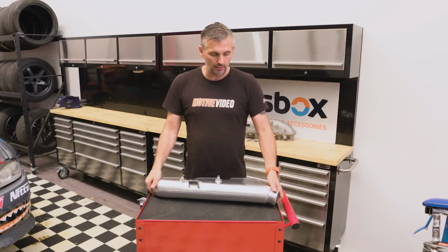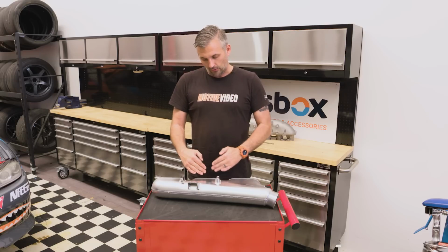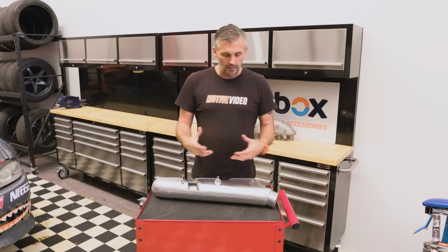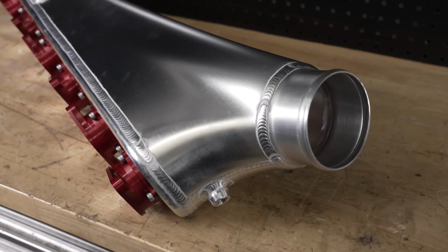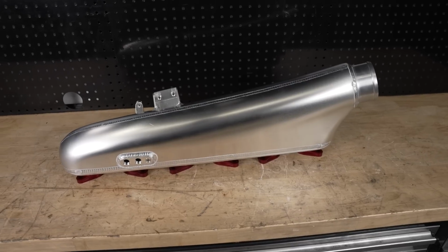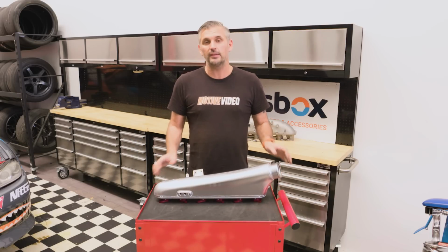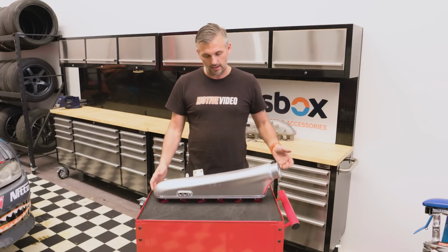What does that mean? Well, technically this is part of the intercooler piping system. It's all pre-throttle body. So you only need to fill it up as you're coming onto boost or if you drop off boost between gear changes. So this sort of change in volume is kind of like having 2.5 inch piping instead of 2 inch piping in your intercooler. It's a little bit more to fill up. Will you notice it? Some cars not so much. Some cars you will a little bit. But obviously the extra volume means you can get better distribution of air to each of the cylinders, which is what's important with the aftermarket inlet.